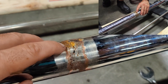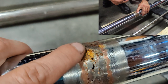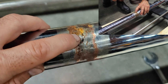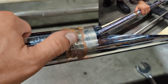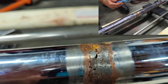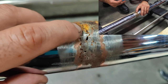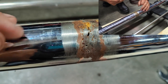Having flipped the axle over, the underside looks worse than the top side did. It's showing a little bit of rust, which I'm actually going to call a good thing because I know it's mild steel under there, so I'll be able to weld it nicely. When I'm done I'll throw a coat of paint on it to keep it from corroding. The weld definitely looks cracked all the way around. I don't know how much of a pain it's going to be to actually split these two pieces, but first things first is just getting it cleaned up.